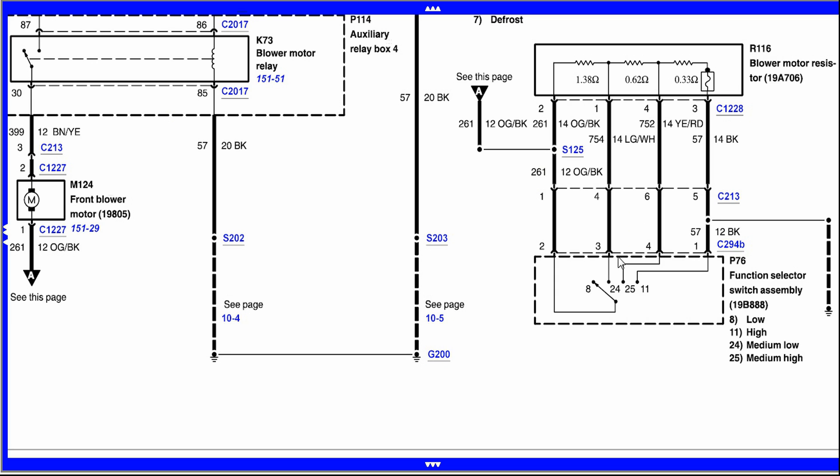You're probably wondering — isn't the ground still coming in through here and going through the resistors? Well yes, but current is going to take the path of least resistance, which of course is this direct ground circuit. So it goes right on through, provides that perfect ground, and totally ignores all the resistance in the circuit. It's the same idea as if you had a problem in a circuit and overlaid a wire to the output side — your component is going to work just fine because you're providing that perfect ground to it.